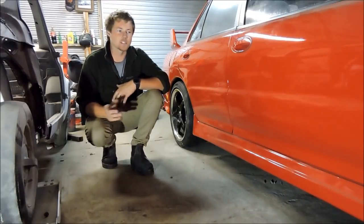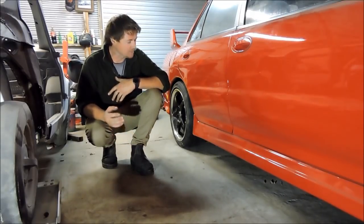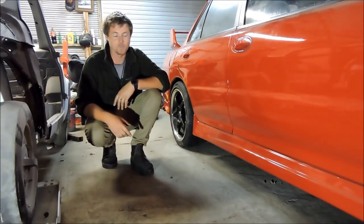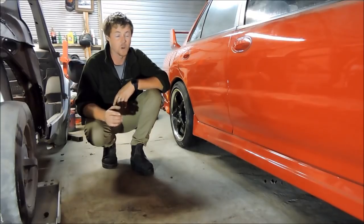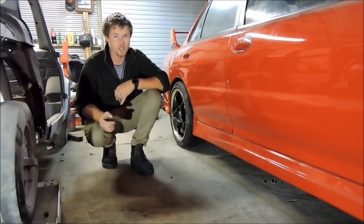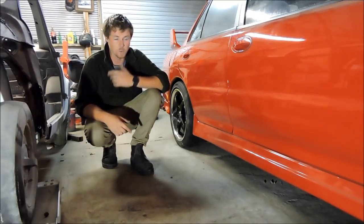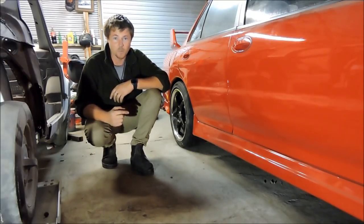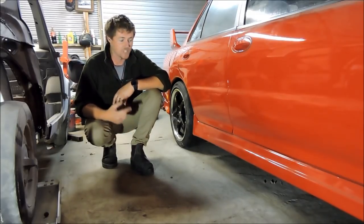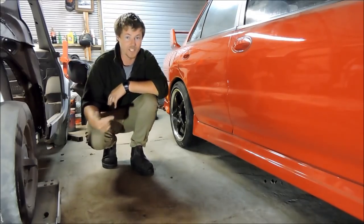Alright, so it's a couple of days since we put the springs in. It's time to jack it up — I'm going to pull the gas tank out and see why this fuel pump's not going. In a couple of videos ago we started it with ether. I'm positive it's not getting fuel but it's getting spark. So we'll pull the fuel tank out, run a battery straight to the fuel pump, and make sure it's working. With this car I can't get to the fuel pump through the back seats or the boot, so it's a case of actually dropping the fuel tank out.